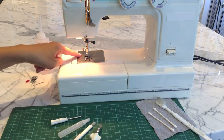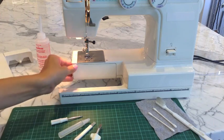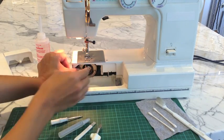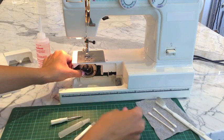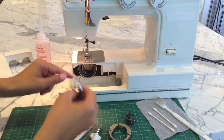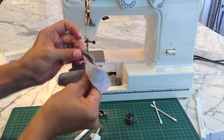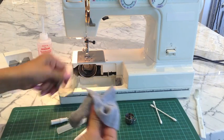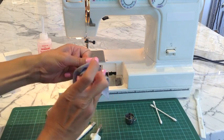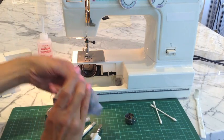I can use the screws to take off my throat plate, get in there and dust it around. And then in the front of my machine I'll take off this extension — flip this down. I want to clean out in here and oil in the back mechanism. First pull out your bobbin case, and then pull out this whole hook mechanism. Another thing you may want to do is put a little bit of the machine oil on your fabric, so that when you're wiping and cleaning it off, you're distributing a little bit of oil on there as well. Make sure you get some right at that hook portion, and then get in around the back too.